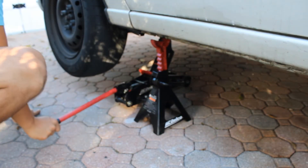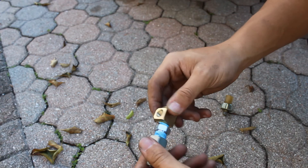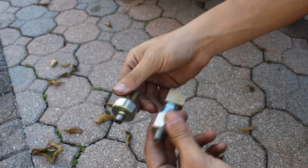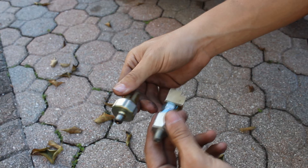Now I need to get the green wire plugged into the sensor, so let's move on to underneath the car. When I was editing this video I realized I really didn't do a good job explaining how this was going to be connected to the engine. Basically, where you see that arrow pointing, that little tip would go in place of the old stock oil pressure sensor. Then I have a series of adapters leading up to a T so I can connect both my aftermarket oil pressure sensor for the gauge and my oil pressure sensor for the car's computer.